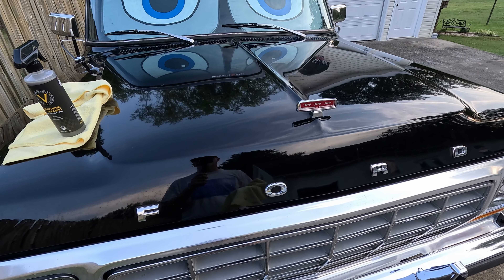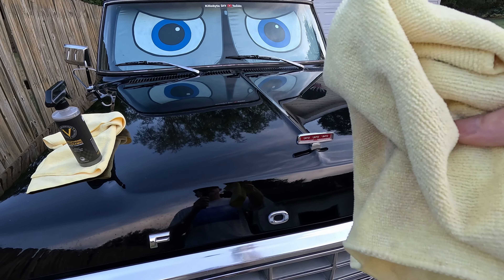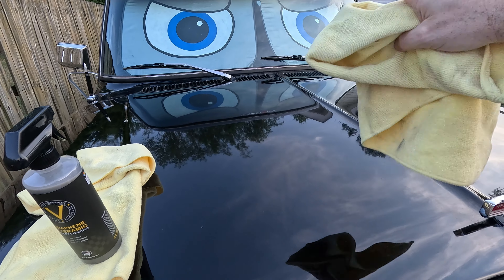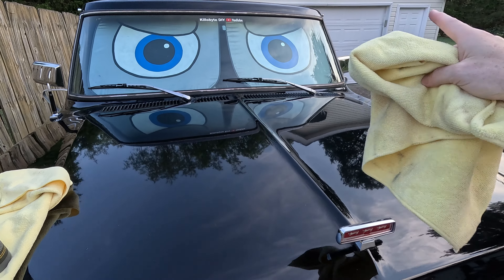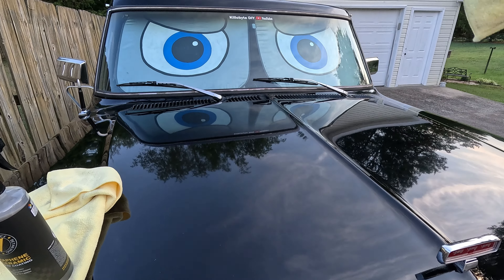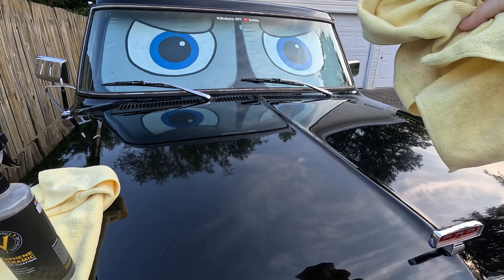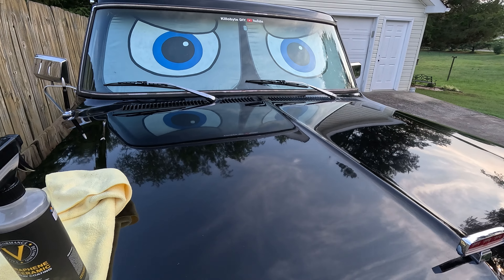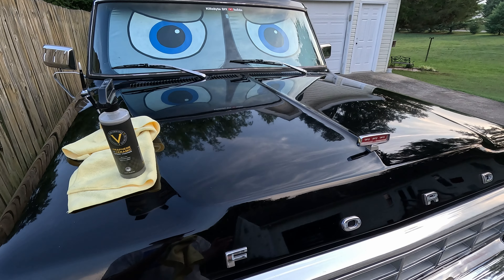Now you can put it on the windshield, but I don't ever put this kind of product on the windshield because a lot of times your wiper blades will just slide over the water. If you're going fast and it beads the water up and it rolls off — great — kind of like old Rain-X. But it tends to make your wiper blades not really work as well. So I personally don't put it on the windshield.